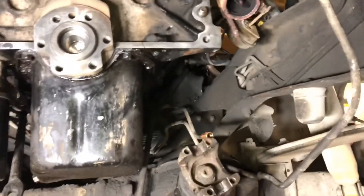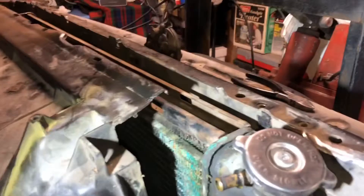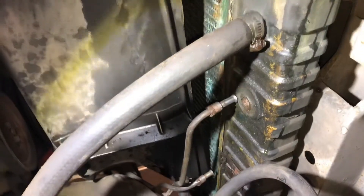I also worked on the cooler lines connected to the radiator. The top one I could barely get - I had to get the vice grips out. The bottom one came out good. I took the fan shroud apart. You can see this radiator - it's just totally wasted, so glad to get a new one in there. I also cleaned out the dipstick tube and made a modified dipstick.